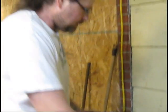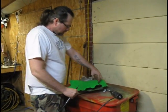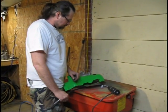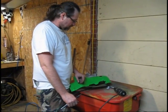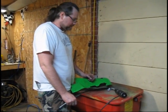Alright guys, what I'm doing here — I had to take my cooling tin back off. It was wanting to stick up under my intake manifold, which would make a manifold leak. You can't have that. So I'm just taking enough off of it to where everything is clear and bolts down in place the way it's supposed to.